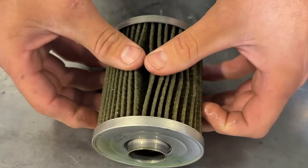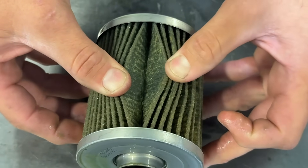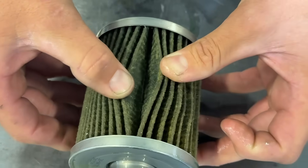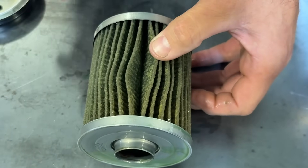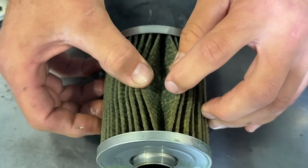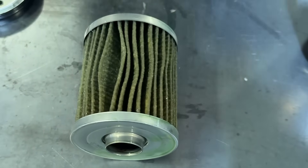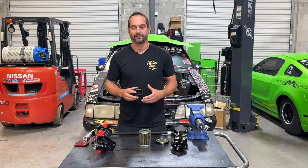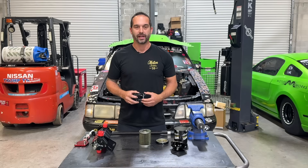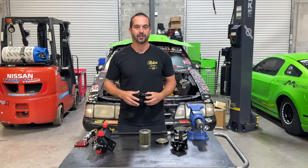The fragments really settle into the center folds, so peel them back and look around — you can see like one tiny speck of aluminum here, which looks pretty good. We'll post images of some really bad oil filters so you can see the difference. When it's bad, you're going to know — if you have a bearing issue or something making contact, there's going to be a lot of material and it'll be obvious. So just visualize the oil flow: out of the pump, out of the engine, into the filter, back into the engine. If it helps, draw a little diagram before you do your plumbing. Thanks for tuning in — if you have any other tech tips you want to see, let us know. We'll see you next time.